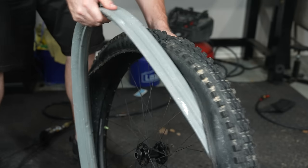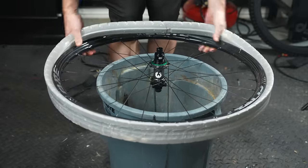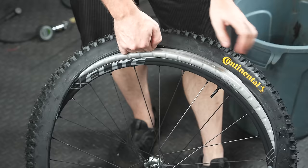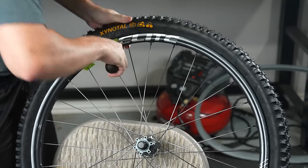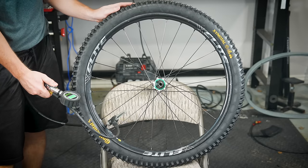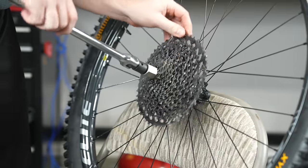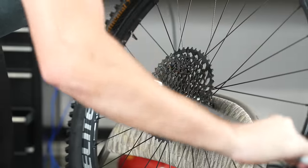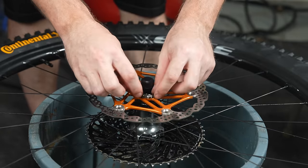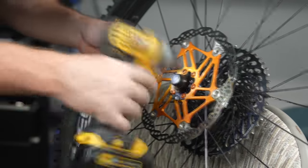Of course I'm using CushCore with these carbon wheels — I learned my lesson before snapping a carbon rim without them. This is an e-bike specific CushCore, and I'm really impressed with the longevity; they're expensive, but I've never had to replace one and they look just as good as new. This e-bike came with center lock rotors with a speed sensor built in, so when I upgraded it, I had to jerry-rig a magnet to fit my 6-bolt rotor and even had to grind it down so it didn't contact the frame. I tried riding without it, but the Shimano motor said nope.